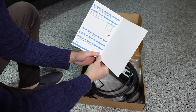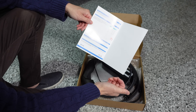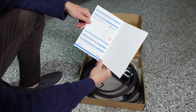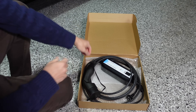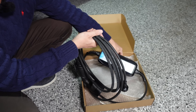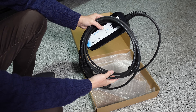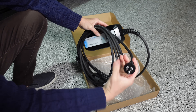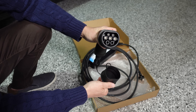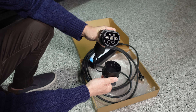The best thing about this product is that you can actually export your charging data — whether you need that for tax purposes or to claim back from your employer, it certainly comes in handy. Inside the kit everything is laid out as one single unit — no separate 8 amp or 12 amp tails, just the one 8 amp tail. It's Type 2 on the other end, same as the Tesla UMC, so it connects not only to Tesla vehicles but to most other modern EVs as well.